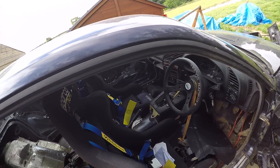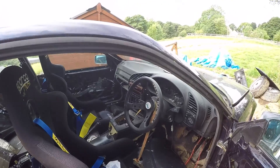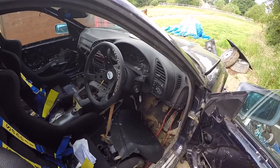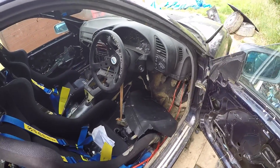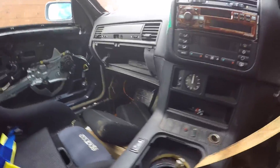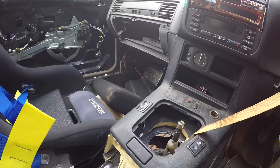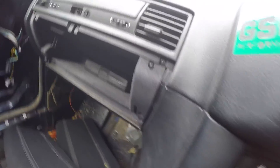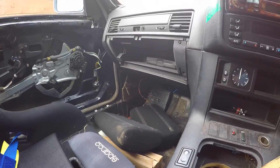So it's another day, and after all that excitement of yesterday, I actually forgot that this car starts with EWS, so that's why it wouldn't start. Let's talk about EWS so that you need to do this before trying to start the car. The first step is to remove the glove box — you've got quite a lot of bolts, about eight bolts, so let's get that off.